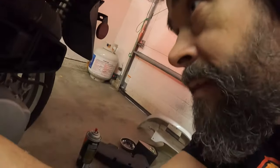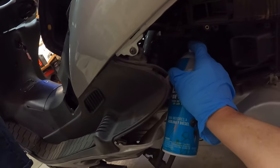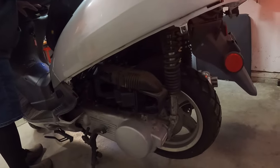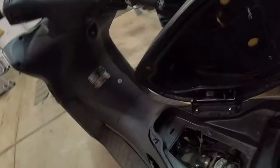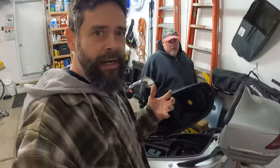We're going to up the game a little bit with some actual starting fluid. Give me more of a squirt — the tire was moving. Is the bike in gear? There's just no fuel supply, I guess. It ain't running. There are fuel delivery issues, like Dr. Torx said. Next we need to pull a line so we can drain fuel directly into the carburetor. Tom had a great idea: if we fill the fuel bowl that way, we could see if it runs for a while. We just can't get to it right now, so we're going to start stripping stuff off.